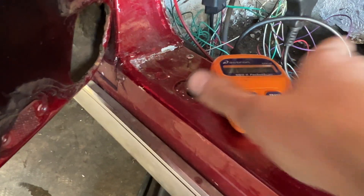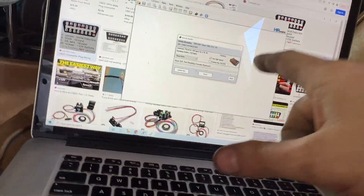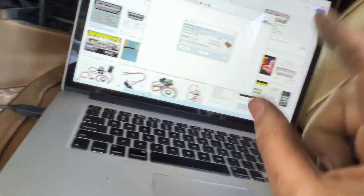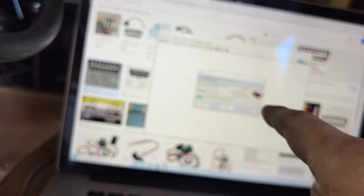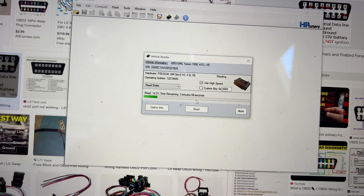My little scanner tool didn't work, but the HP Tuners does seem to work — GM Gen 3 V8. Looks good. No idea why that didn't work, but we'll ignore that for now. This is what's important. It looks like we're downloading data from the ECU, which is awesome.